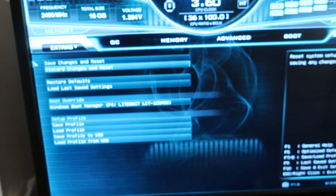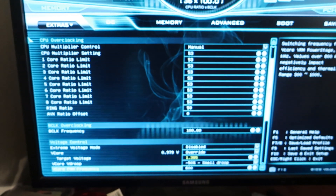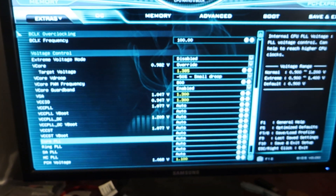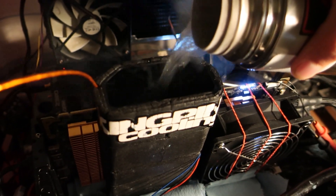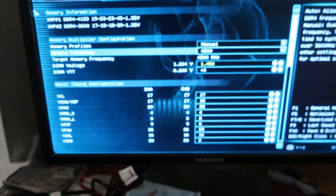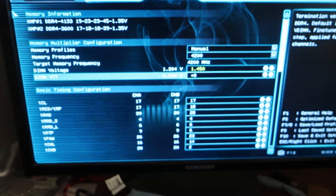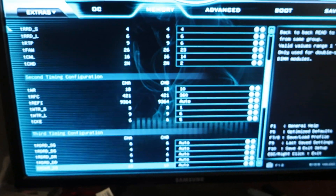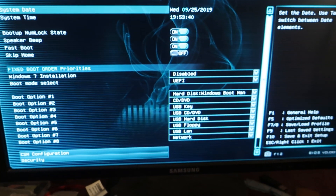The fan is quite loud so it's not easy to talk. I'll just load the profile: 5.3 GHz core, 50 on the cache, 1.385 volts, 1.3 VCCIO. Memory is at 4200, 1.45 volts, 17-18-18-28, Command Rate 2, 360 on tRFC. There are many auto sub-timings, not so important.